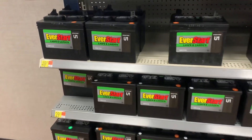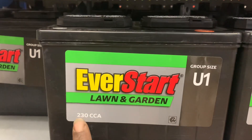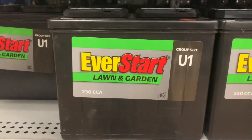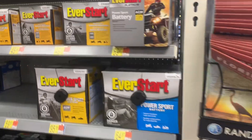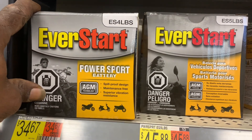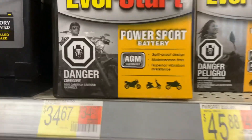We got this battery right here, and I was telling y'all to look at what the CCA is — that's pretty much for the type of mower that we have, which is a commercial mower. You can also buy these types of batteries where you put your own acid in yourself; they're a little cheaper, but you do have the danger of burning your hand from the acid.